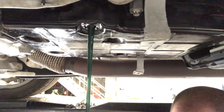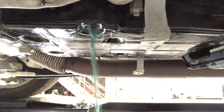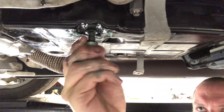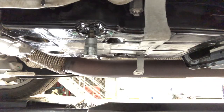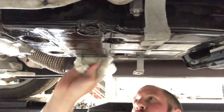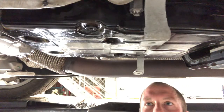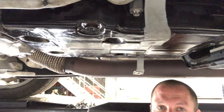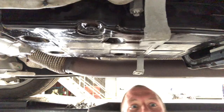All right, it was overfilled quite a bit. And that's it - it'll do it just like that. We'll put our drain plug back in. So that ensures we're at that level with it running when it's hot. Five quarts was a little over full - it probably took four and three-quarter quarts, the rest of it drained out there. You want to ensure that you have enough fluid over top of that little thing while it's running until it's hot to satisfy everything it needs pumped through. And then once it's pumped through, we take it off and that's our level. We put it back together, and that's it. Let's go ahead and wrap this up - we'll put these covers back on and we'll see you back at the Durbin Compound.